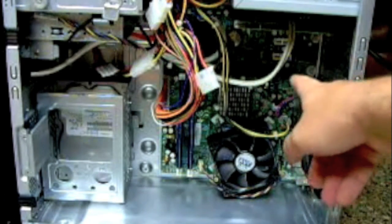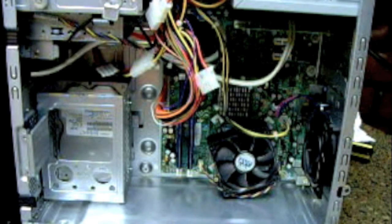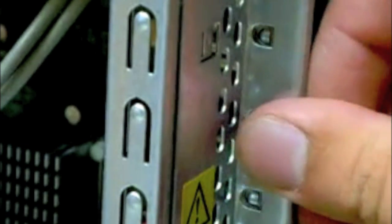Here is where our PCI card slot section is, and that is what we need. The door section for the PCI card slot actually has a little security door itself. That's simple — you just take a screwdriver, your same Phillips you can use, just unscrew it. Lose the screw, take that out. You have access to take out any one of these that you want. This top one is actually a modem for a telephone — I personally don't need that. I don't know of anyone who uses that anymore, because the whole world is on high-speed broadband.